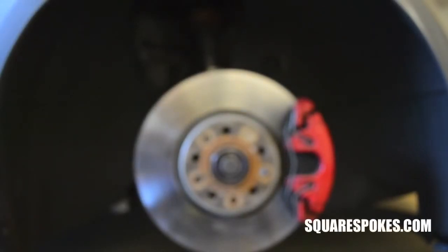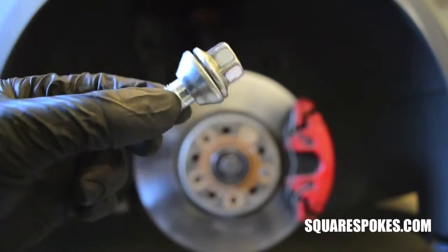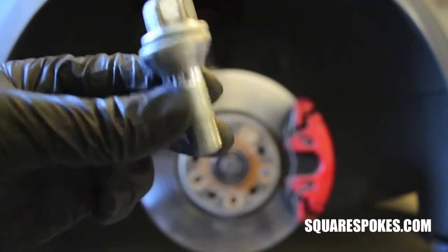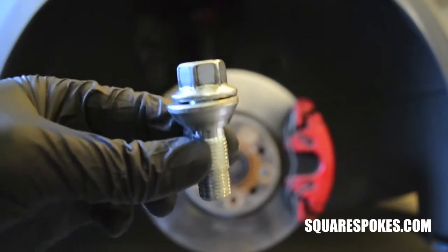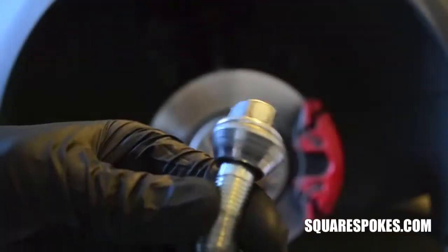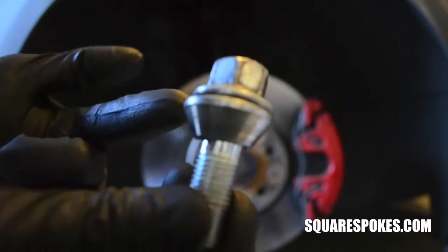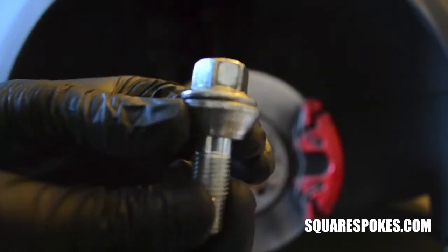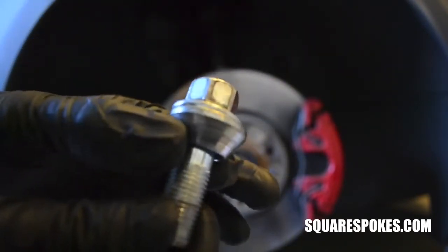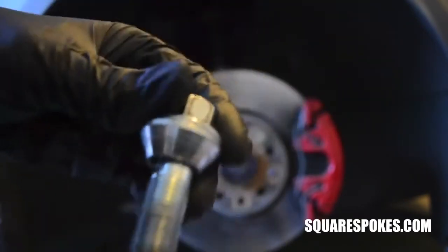So how does any of this have anything to do with wobble bolts? Well, wobble bolts are actually a lug pattern variation tool as well. Just by looking at it, you can't really see what it can do to allow you to run wheels that have a different lug pattern than your hub. So what is the magic? Well, of course, there isn't any magic to it, it's just a really simple yet clever design. The seat of these bolts wobbles like this, like the name suggests, which gives you the ability to run wheels that have a different lug pattern than your hub. So that's how they work.